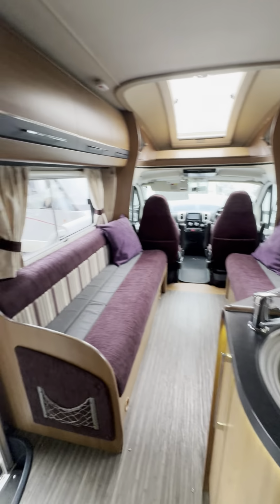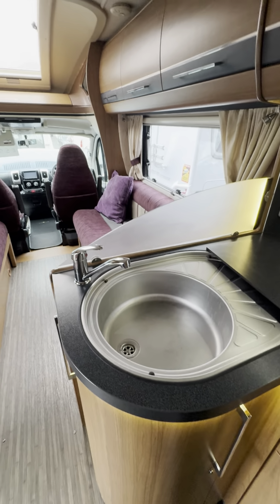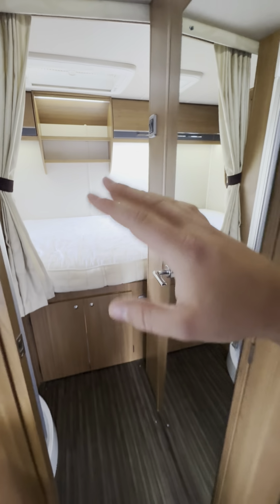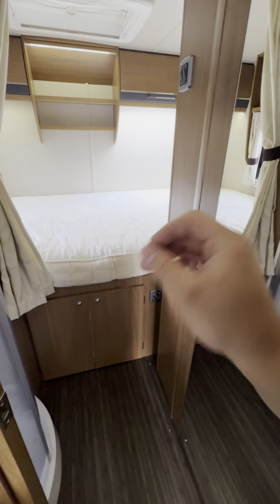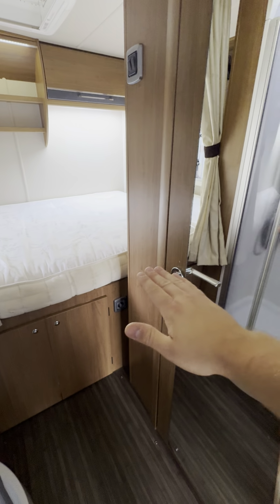So, as I was saying about the boiler, if you want to get the water hot inside of it, you do have to make sure of one thing, which is just to make sure that the boiler is actually full. So the only way to do that, two things: in the garage at the back, where I showed you where that little yellow tab is, first of all, just double check that it's definitely still laying down flat and it's not upright.